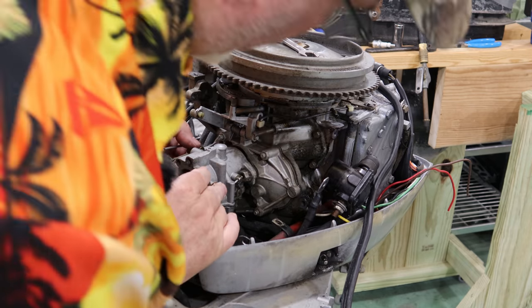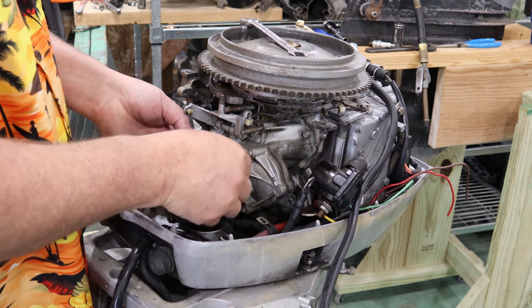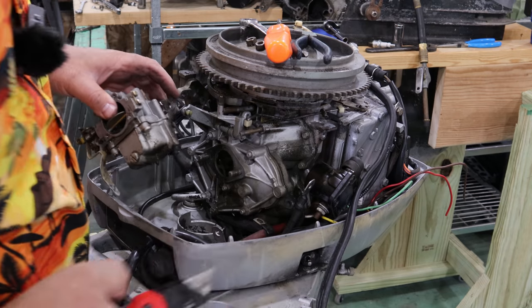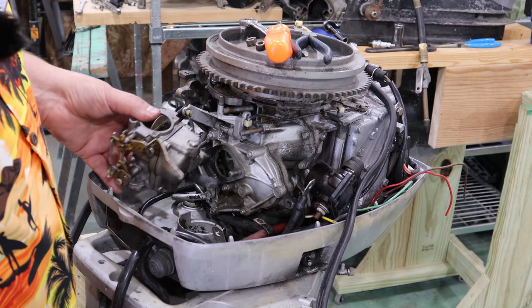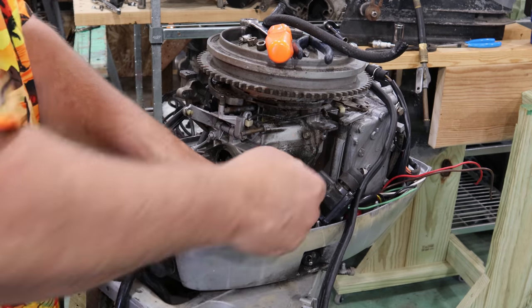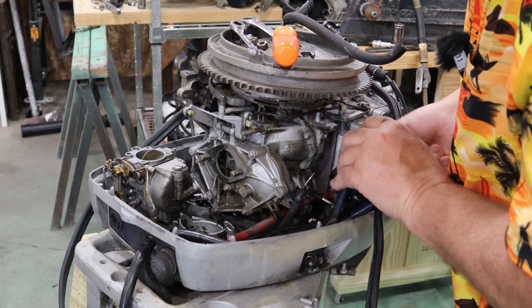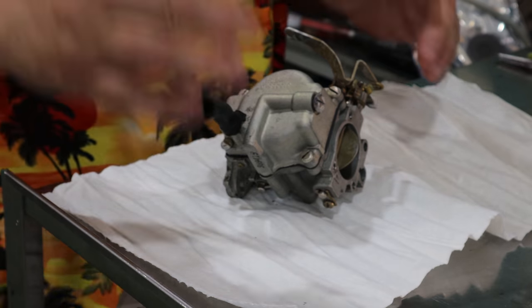Now there's a hose that comes into the bottom of the carburetor. It comes right up through a groove and everything. I'm putting new hoses on it anyway, so this is going to work out just fine. Oh, fuel line, so dry it up. It's no longer even limber. But the carburetor is now off. Fuel line out of here. Crowd a bunch of stuff underneath this little hood. Alrighty, we got the carburetor off here. Let's go ahead and pull it apart.